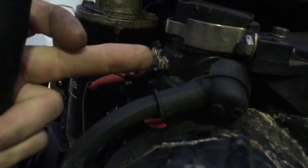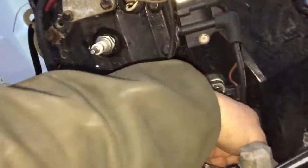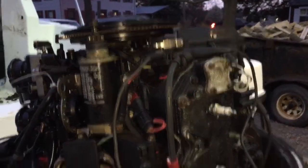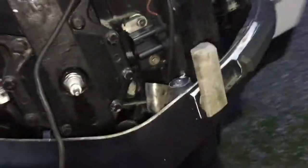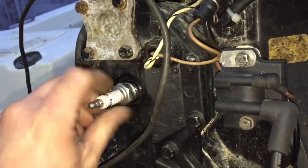Connect another jumper there. Once your jumpers are connected up, make sure your key is on — my key's on. You can take your push button so it turns over. Now what you can do — my spark plugs, like I said, I already went through and tested some stuff — so you can take your spark plugs out.